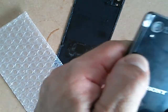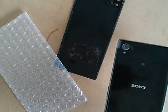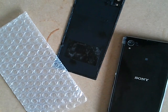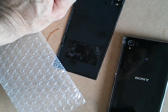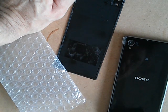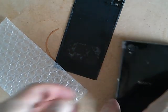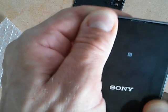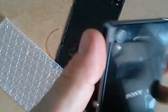Lovely — I'll press it all the way around just to make sure it's on. For a belt-and-braces type of approach, I'm going to give it a little bit of hot air just to warm it up and make the glue a little bit pliable to ensure a good seal. Just push that all the way around — not too hard, hard enough. And that's it — my new back. I'm not going to peel the film off just yet because I'm selling it in a few days and I don't want to scratch the new back before I've had a chance to sell it.